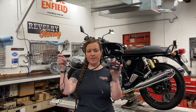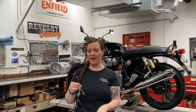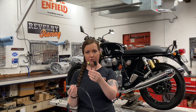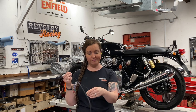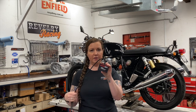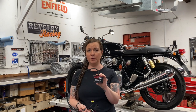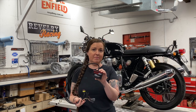Because they're very different we're going to cover them individually, starting with the DynoJet Power Commander 5 fuel module. This is the harness. The square box here is the module. You have piggybacks for your fuel injectors, for the throttle position sensor, and a ground wire. That's it. Pretty uncomplicated.